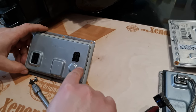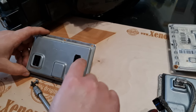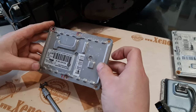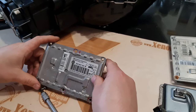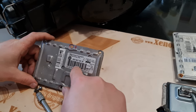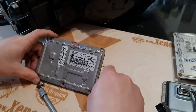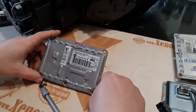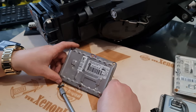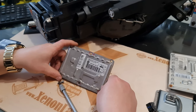As you can see, there are 4-pin openings in the power plug — that's why it's named as 4-pin. The Volkswagen corresponding part number is 3D0907391B. This is one of the most common ballasts. You can find it in other cars as well, like BMW, first series.